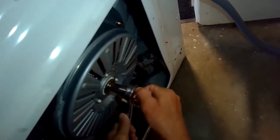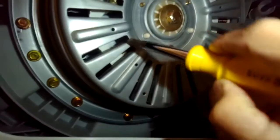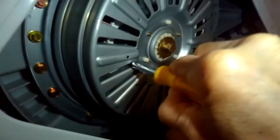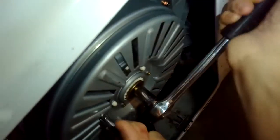I'm going to put on the ratchet. One thing you can do is put a standard flathead screwdriver inside these vanes, about a quarter inch in, and then you can see that it's going to get caught right there. That keeps the rotor from turning and makes it easier to get this bolt to come off - it holds it while you're spinning that bolt off.